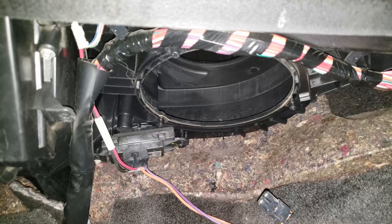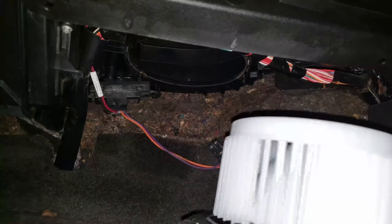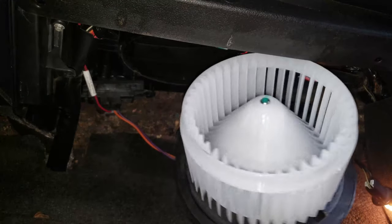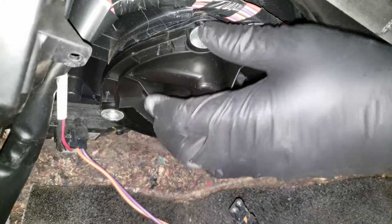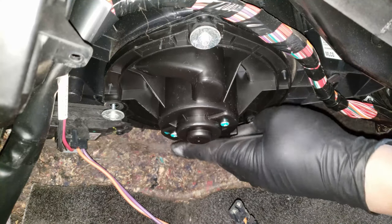This is where the blower motor mounts. There are three nubs where the holes on the blower motor housing slide into. So when placing your blower motor, you'll want to make sure all three slide in when reinstalling the three screws. Now that you've got the three screws loosely installed, you'll want to make sure that it sits flat, so you can begin tightening the screws.